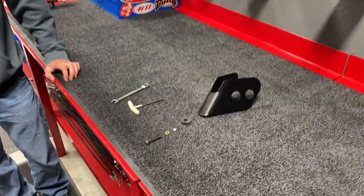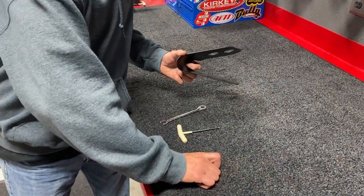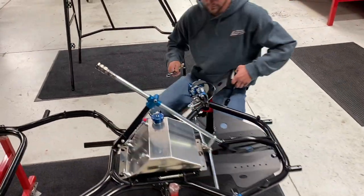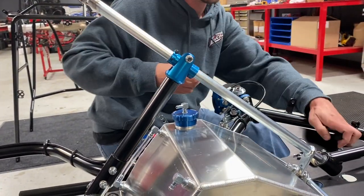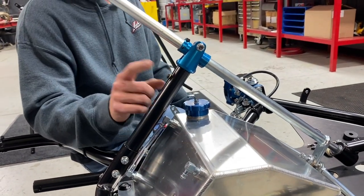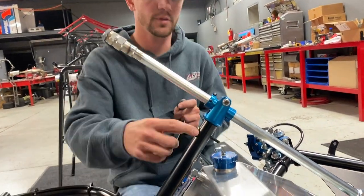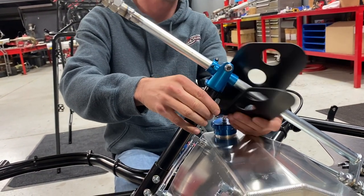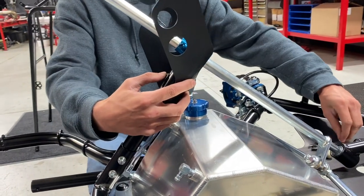The final part of step six — the steering column — is our knee guard. We'll take our hardware, rubber grommet, knee guard, our 5/32nd allen, and our 7/16th wrench. This is a pretty controversial deal — we've seen a lot of comments on Facebook and pictures of people putting the knee guard in different directions. There are two ways and I don't think there's a right or wrong way. We'll put the bolt through this way, take the rubber grommet, and put it on in this direction.